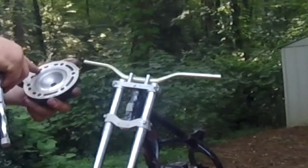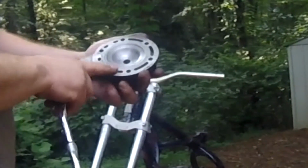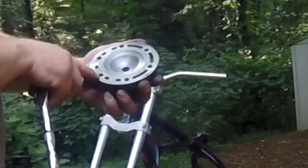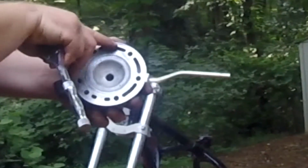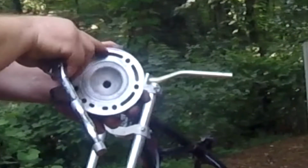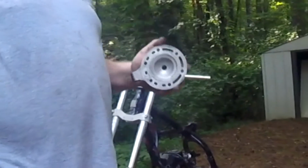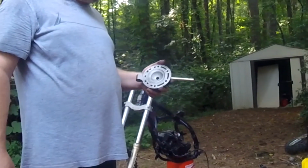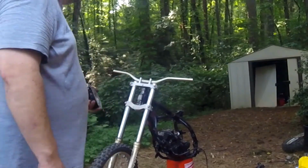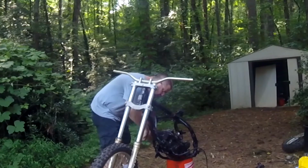And it's got a slight warp in it from the last time it blew up. You can tell because see how shiny it is over here on this side? And see where the gasket marks are there? And this side here is marked in a totally different way. Why did that happen? Well, that happened because the last time this blew up, it got slightly warped by a couple thousandths of an inch and nobody refurbished it at that time. Oh, somebody jammed the wrong bolt in the wrong hole.